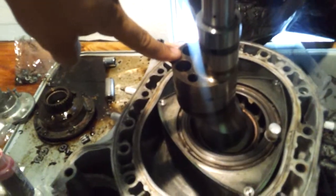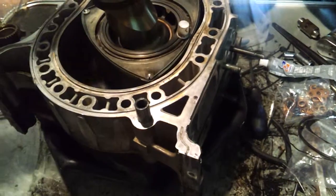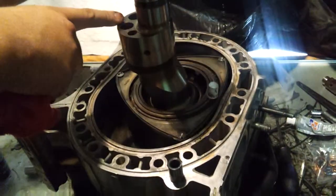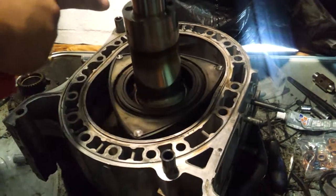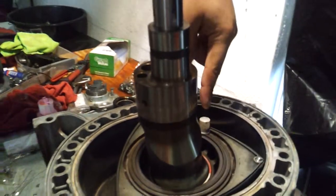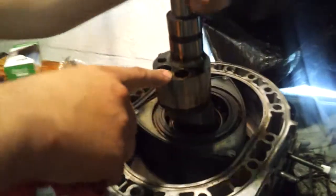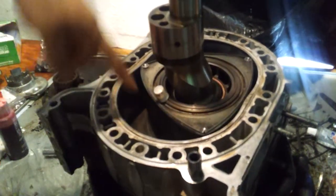This right here is the top of the crankshaft — use this point as a reference. Watch: this goes around all the way around. That's one full rotation of the crankshaft, and the rotor has only made one third of the turn. Another rotation — that's two rotations, and it's now two thirds of the way.